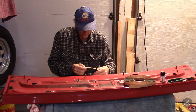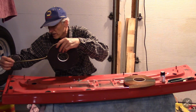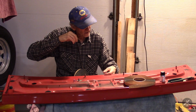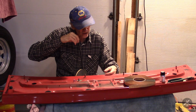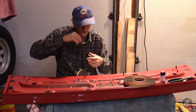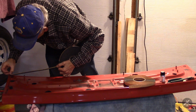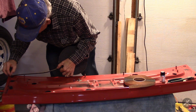So let's start by putting this down all the way across. This is a 15-foot roll. Again, the book shows putting both of them at the bottom of this lip, and the factory, as it was built, was a little further back, and the butyl tape is kind of on the edge. I think I'm going to try to duplicate that, but maybe a small bit further forward. So let me see what I can do here. We'll take this right on out to the end. Right there.